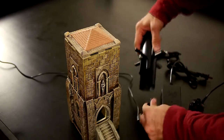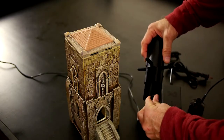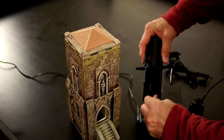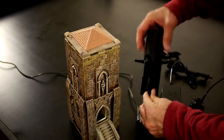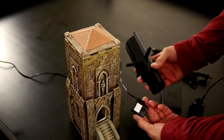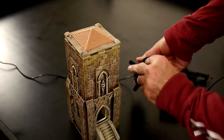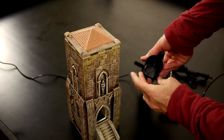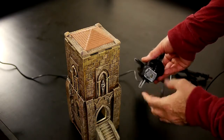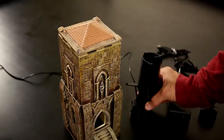And the first thing that you can see is we have a little black plastic elbow that goes right on the water tube. So when you get yours, if that's loose, just put that on top of the water tube and look for the hole in the pump. And that's going to go together just like this. And kind of take it and just center it inside there. That's not really super important, but just to have it centered there so that it sits right.